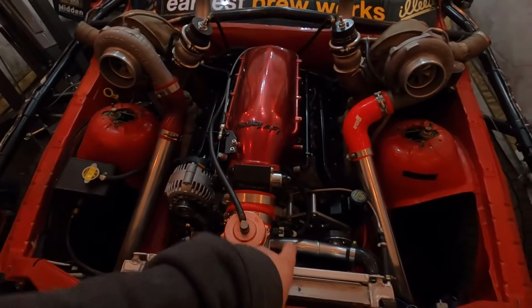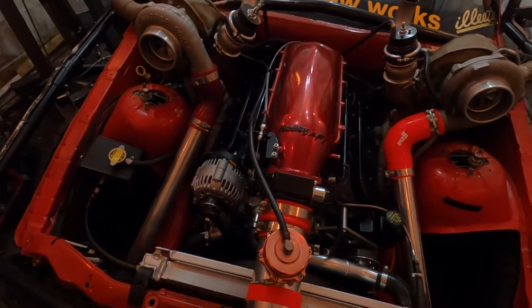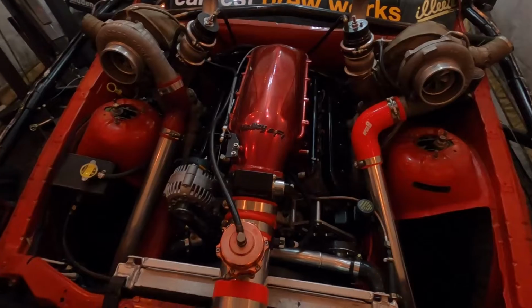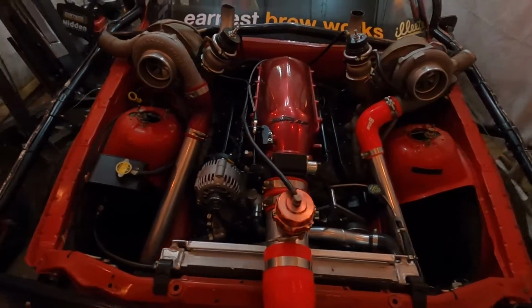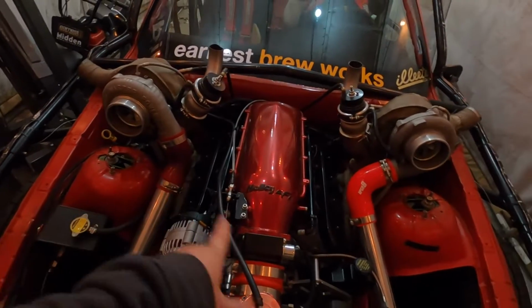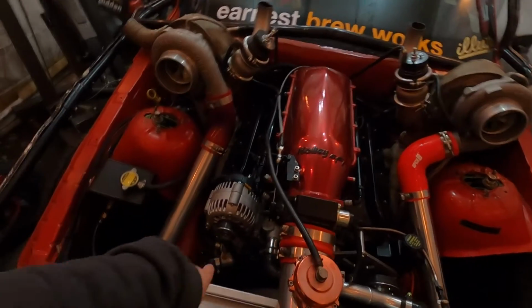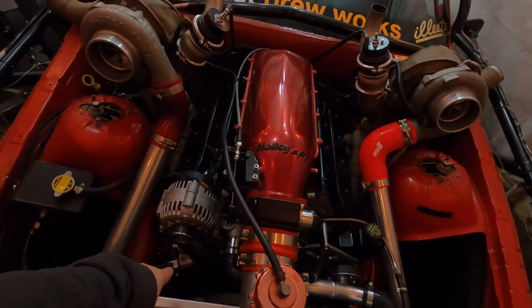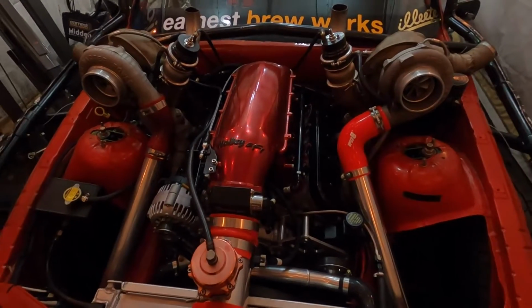And then, of course, you guys know about the head gaskets that were put on upside down, and then I tried to flip them over, and we tried to make it work for the burnout contest, but it was just pouring out coolant. So we have to pull the heads off again, which requires getting the turbos off on each side, getting this assembly off in the front, and then getting the intake off and fuel rails, valve cover, pull the heads out. And then we will take those to Accelerate Performance. Don will get them machined again. We're gonna get new head gaskets again.